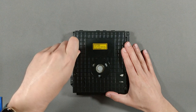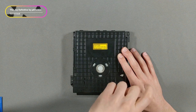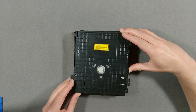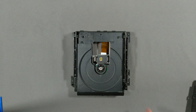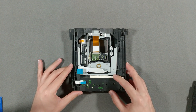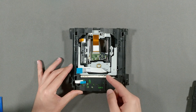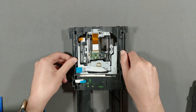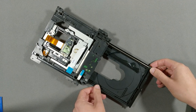Let's come back to the disk drive. There are four tiny Phillips-head screws holding the top of the drive to the rest of the assembly. I found the top needed some coaxing to take off once the screws were removed — a little wiggling should set it free. This small part showing through the disk tray is the laser. Definitely don't touch it, because it's a pain to clean thoroughly. Be careful not to spill anything on it while servicing the drive as well. Let's turn the drive back over and check out the tray's eject action. Start by pushing this white plastic part to the side to lower the laser carriage and allow the disk tray to eject. Mine was so gunked up that it's difficult to pull out even by hand — whatever was used to lubricate this drive was probably too heavy. It's still very shiny and sticky to the touch. I'm fairly confident that's our culprit.